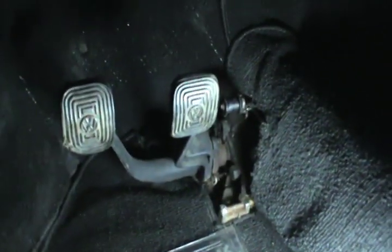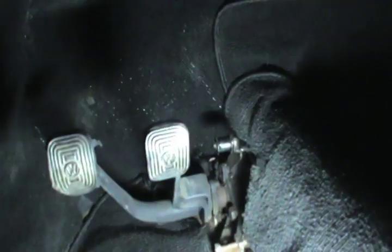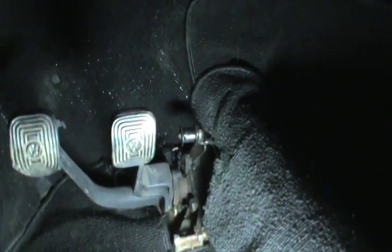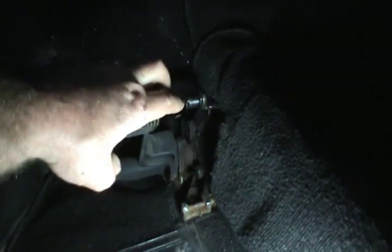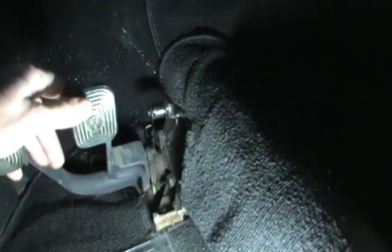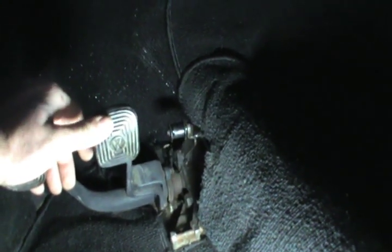With my hikers on, see this is working okay. I can still mash the gas, but with my hikers on I had a little trouble working my foot down in there — it's kind of a small hole. So what I'm going to do is go ahead and get this pedal assembly out. It all needs lubricated anyway. It's one of those things with the Volkswagen that doesn't get much attention.